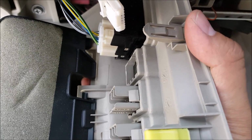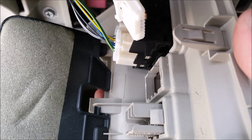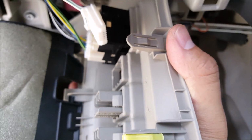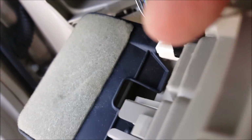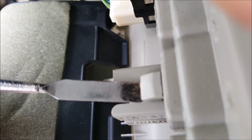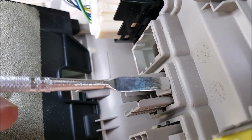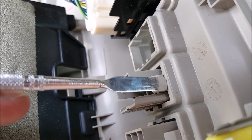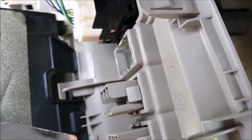So just like that, it is out. What I had to do was insert the plunger tool into that clip underneath it. I'm using this as an example. Use this tool, insert it right there, underneath between the two. While I'm pushing down, use any of my fingers and push the thing out. Just like that. And now I can install my switch.